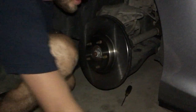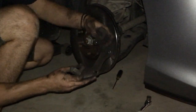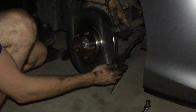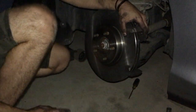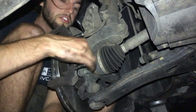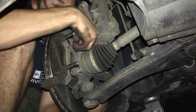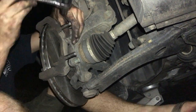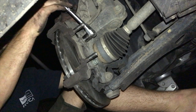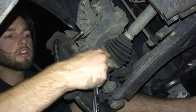All right, now we're ready to put the rotor on the car. I'm going to have Ben help me with the light. Once the rotor is on, sneak around the back — the two base bolts go here. Get them hand-tight first, and that'll get your base back on so we can move forward. Then snug them both up.